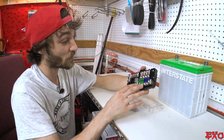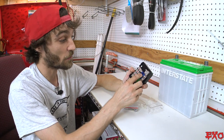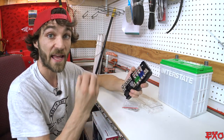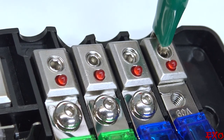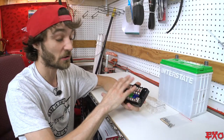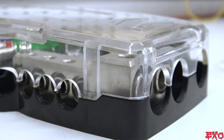What's also really cool is that if anything goes wrong, these little LED lights will illuminate — but not when things are powered normally 24/7. If you have constant 12-volt power going through the circuit, the light will not be on. It's only when you have a problem that it will light up red. I thought that was pretty cool especially for being like 28 bucks. The fuses it comes with are in 30, 60, and 80 amp sizes — definitely enough for powering the accessories I need, the four-channel amp and the mono block amp. I'll probably utilize the biggest size fuse it has.